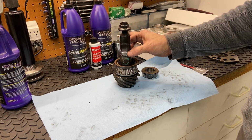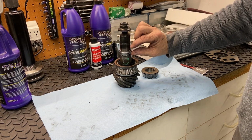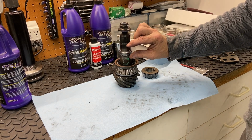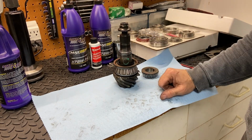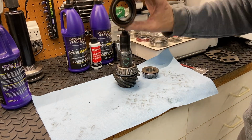Whereas if you used a solid spacer, you would just go to that torque setting. This is never going to compress because the solid spacer is not designed to crush. So you'd always have the proper preload. So it would make it easier to swap out a seal later.